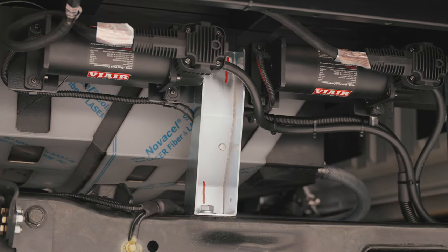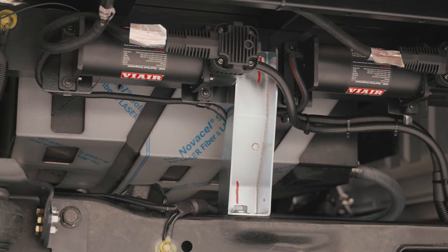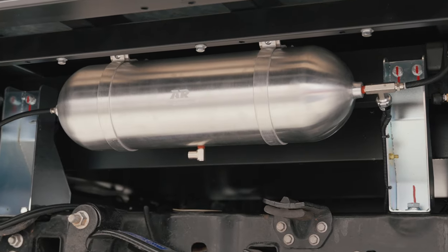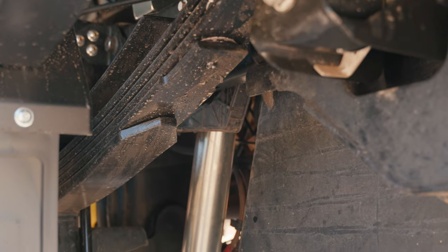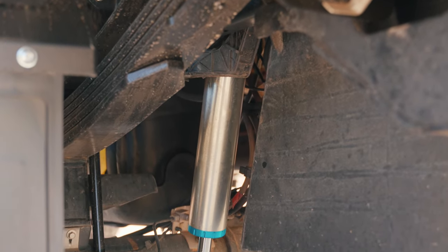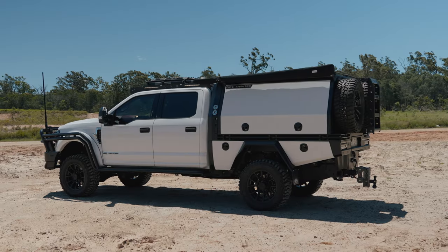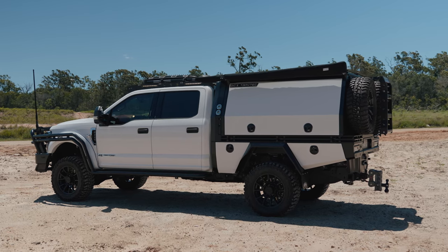After the vehicle came back from GCI Traytech, we've removed a couple of the toolboxes underneath. This is a great location to add air on board to these vehicles. So we've installed a Firestone leaf helper airbag kit. Being a combination and a lift-off canopy, we've also reset the leaf springs to suit the weight of the truck. We haven't gone as heavy as we would for the full-time canopy vehicles. On this one, we've gone a little bit lower.